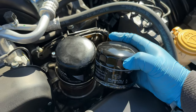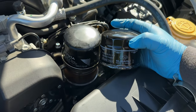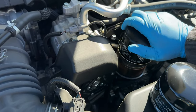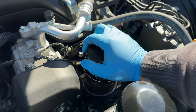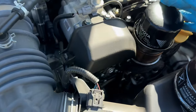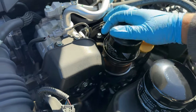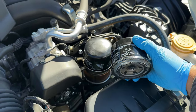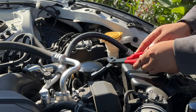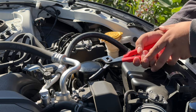Comparing them they look about the same — the new one says Subaru. I had to run to the local auto parts store because I wasn't strong enough to take the old one off by hand. I tried pliers and you can see the scuff marks — that didn't work. So I picked up oil filter pliers, and yeah, that got it right off — easy peasy.